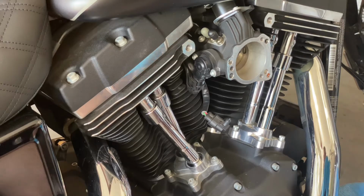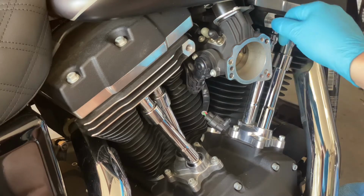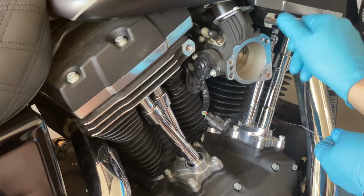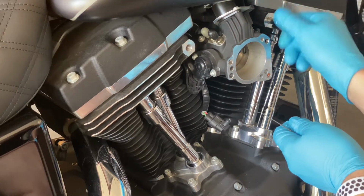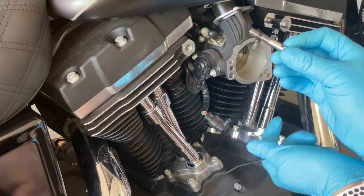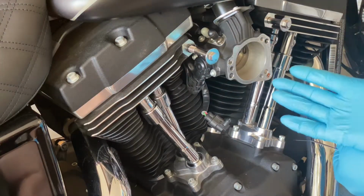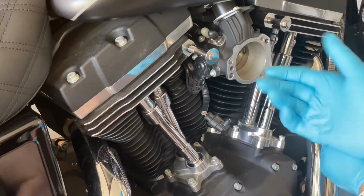So I was trying to screw in, so you can see here they screw in pretty simple. This is part of the assembly. It screws in really easy. Really easy, right? It'll go all the way to the end here. And here, the reason I have a zip tie in it, that's where I was getting caught up. I'd get to this point and it wouldn't screw in anymore. I didn't want to force it in when I reassemble this, because these are aluminum and I believe it'll cause more damage.